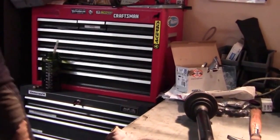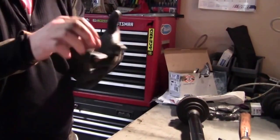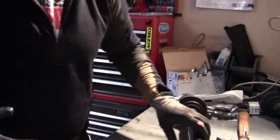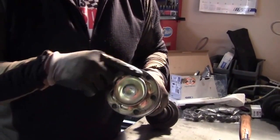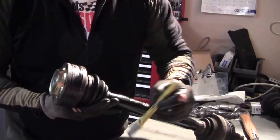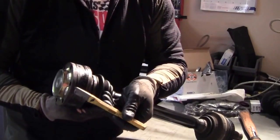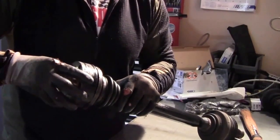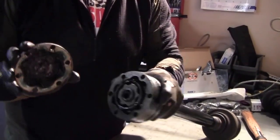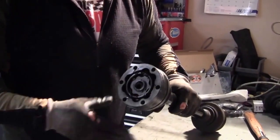Okay we're back. Hopefully that's going to be good enough for you guys to see what I'm up to. Get this end off right here — some of them sometimes are pretty hard to get off; that's what I use the chisel for. I kind of pre-chiseled this one off to make the video easier. Stick your chisel in there and just kind of hammer around it. If yours is soft, this cap will come off. This shows the bearing on the inside. Here's the cap — the cap gets replaced in the kit so that goes in the box.